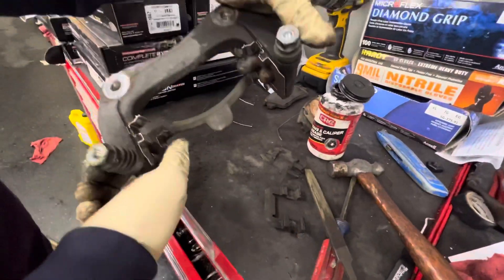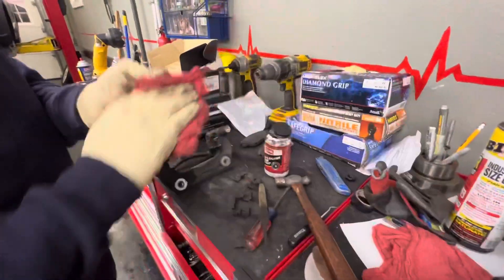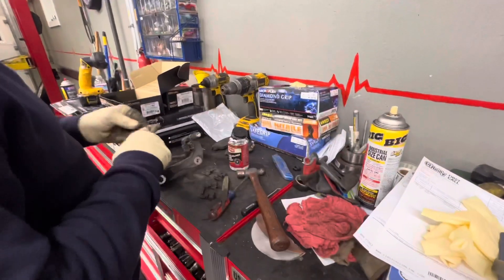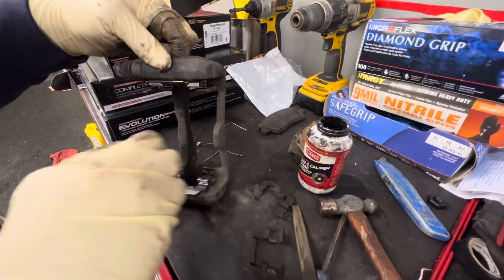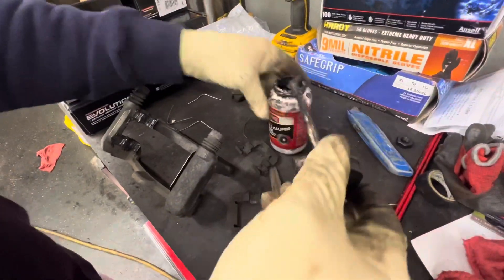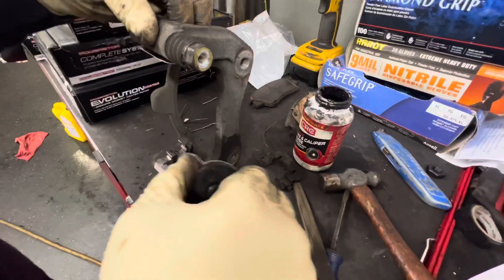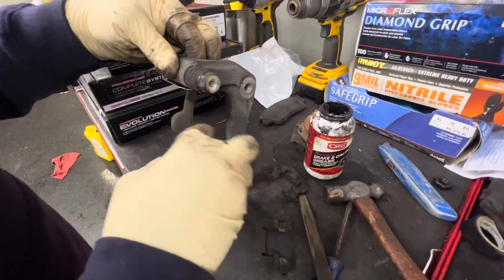Checking they're tight on both sides — okay. Now for the fun part: get your hands clean. We've got a little piece of sandpaper. Take that caliper pin lube and lube up the sleeves where the brake pad rides, so you've got some lubrication in there when you go to put the brake pads in. It just makes it a little easier.